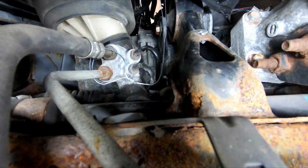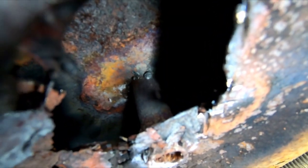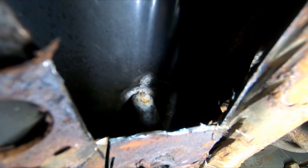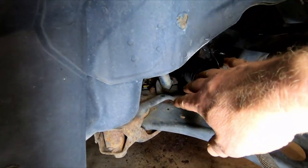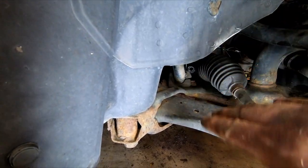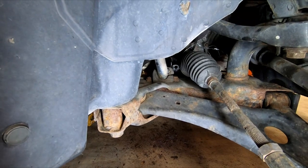We've got the other rack bolt out — the rack and pinion bolts are going to give you the most headache. I cut a hole and heated with the oxyacetylene torch; you can see where I heated it on both ends of the rack — there was no other way. The ball joints are pickled and pulled apart — those were really rusted too. I cut the sway bar end links off since they're pretty well trashed anyway. Alex and I are going to pull this cradle out, leaving the sway bar bolted to it and replacing the control arms too, taking the whole thing out as a unit.